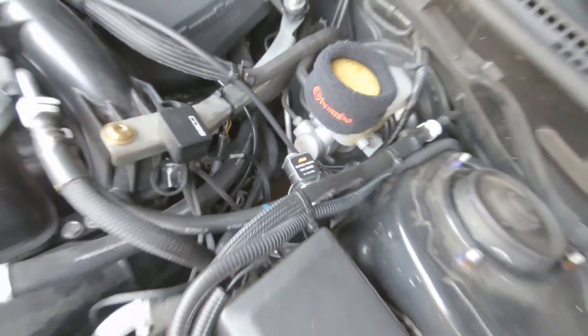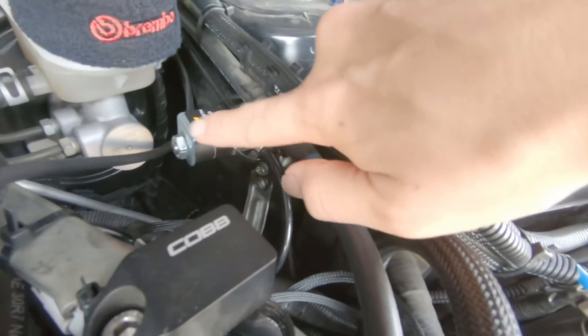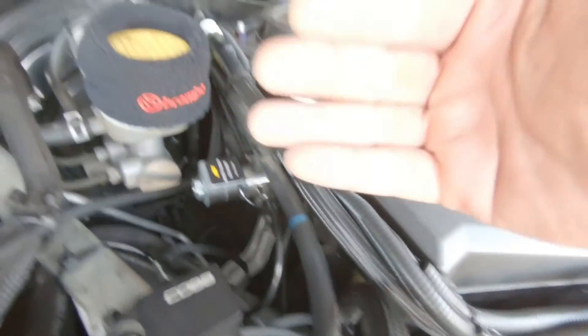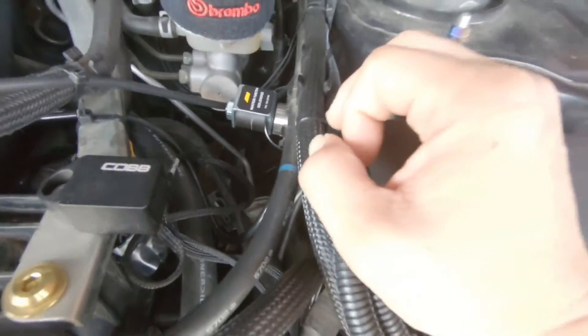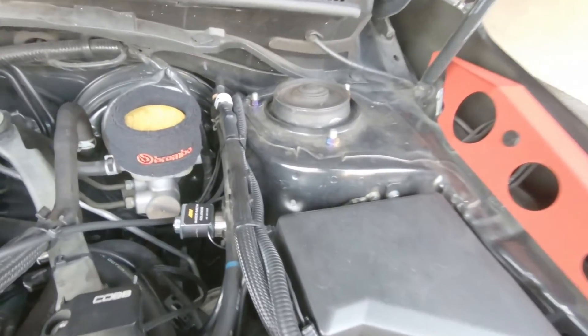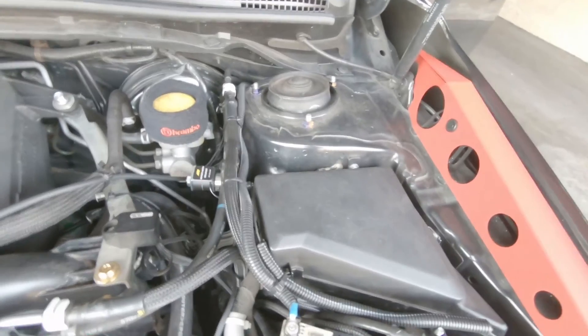The other black wire just goes to a chassis ground. My nozzle is right there. A really easy way to mount the solenoid on 2015-plus WRX guys - there's a little clip bracket that the solenoid literally just clips into. I have it zip tied so it doesn't pop off, but it's been very secure. This way you're not twisting or bending the lines, which some users have reported causes leaks.